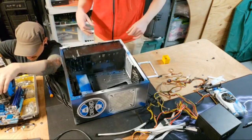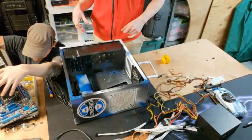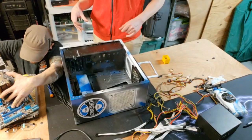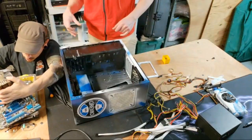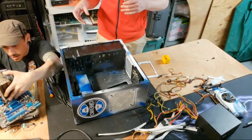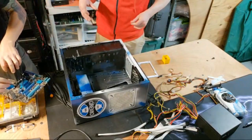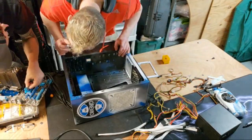It's just a thin piece of metal, so I've actually had to bend these clips for other reasons on other CPUs, like to get them through things and such. Okay. You're bending it downward? All right. Wow. Skills, bro. Yeah, and you'll still be able to take that. That's fine. As long as it's lower than the top of that, so that's perfect. You got it. I mean, even the bracket itself is designed to bend to hold it on. Yeah. And what I would recommend before you stick this in there is make sure that reaches.